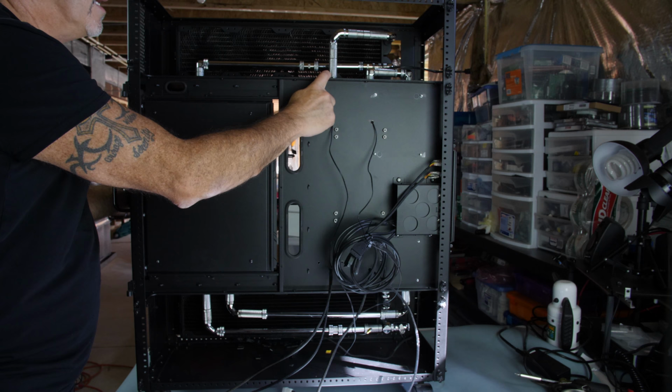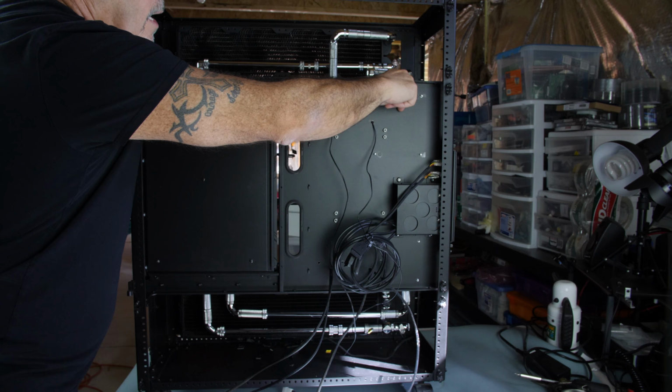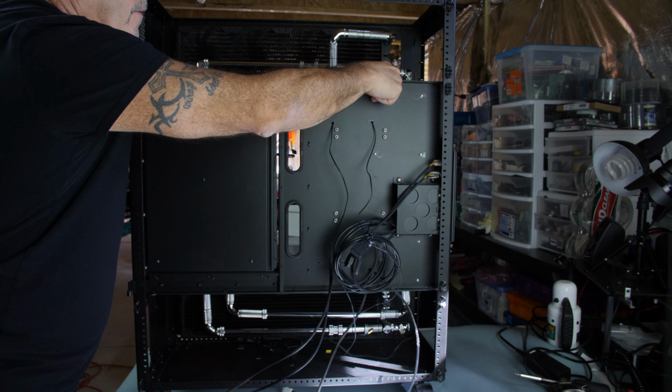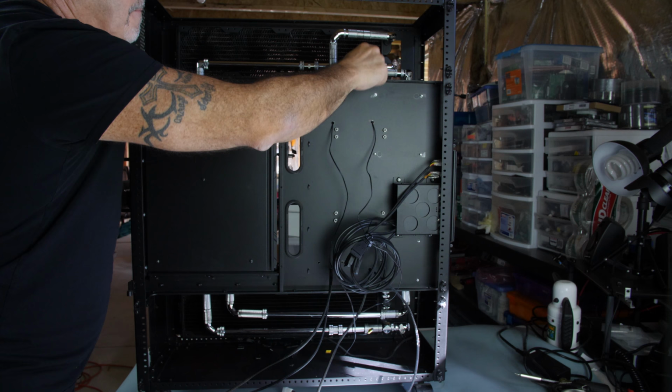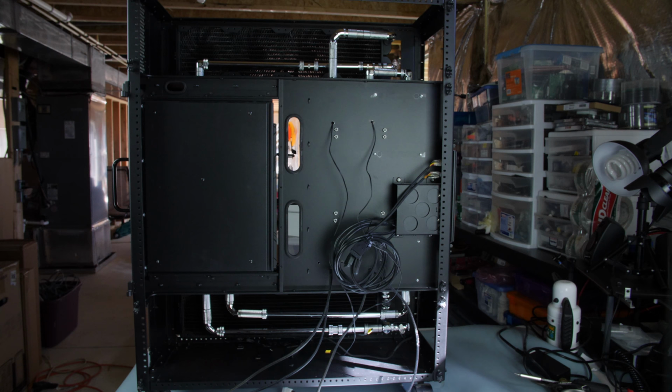And then over here is where we come out of that long tube that came up, and then we have a 90 degree single rotary, an Aqualink adjustable pipe there from Bits Power or Barrow again, and then over here is like a 40 millimeter extension, a 15 millimeter extension, and then a 90 degree rotary. So I used just about all of my stock of extension fittings that I've had.